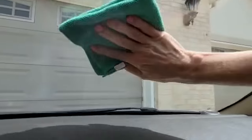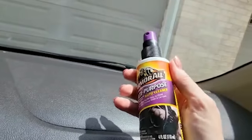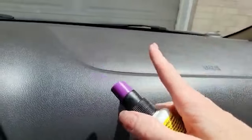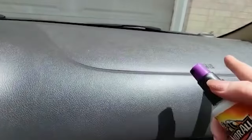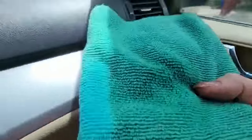Use the alcohol to clean the grease and oil off your windshield — both methods do a great job. Then the final step is to grab your glass cleaner and spray it directly onto your microfiber cloth; don't spray it onto the windshield because you don't want the spray falling down onto your dash. As a side note, if you have any dripping from the melamine sponge or the alcohol, clean that up right away — any product that falls on the dash could stain it. Then use the cloth to give your windshield a final polish.